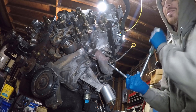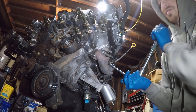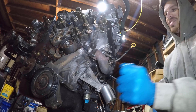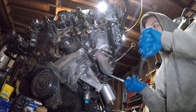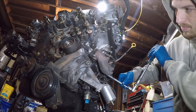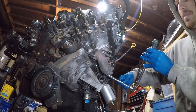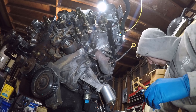This one feels awful — oh my god, I wonder if I'm pulling the stud out. No, the nut's coming off. Oh my gosh, it sounds like it's galling. It seems fine now. Whenever you do the twin turbo manifolds on here, you have to swap studs out — there's a different stud pattern for some reason. Very weird. I don't know why that was making that noise.